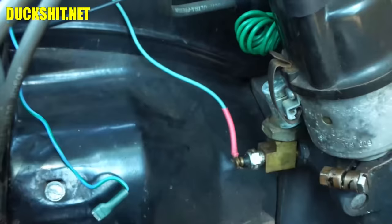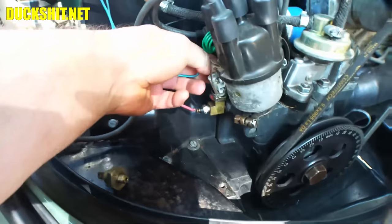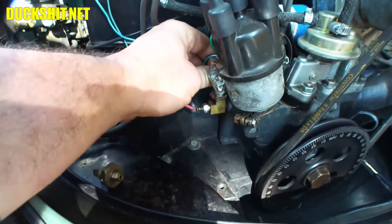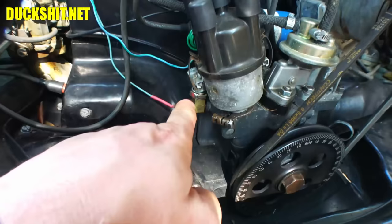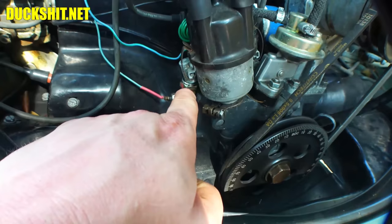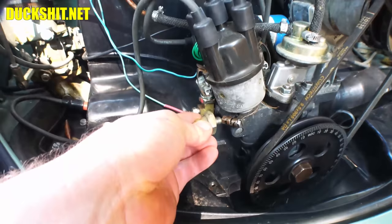The new one is in place. Let's put our wire back on it. The new one already had its PTFE tape on the threads — this old one doesn't appear to have any. It also had a compression washer on it, which is nice. It tightened all the way down to the compression washer, and I just gave it a little cinch with an adjustable wrench, because I don't have a regular wrench that fits that for some reason. And I can't get a socket on it like I normally would on a stock Beetle because it's in the way of the distributor. By the way, this 009 is getting replaced too in this video.